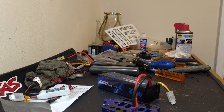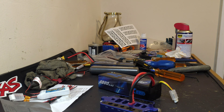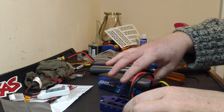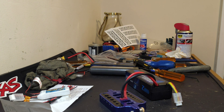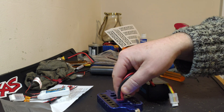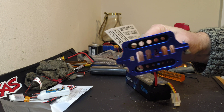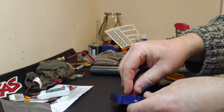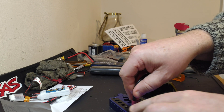Hello YouTube, welcome back to WTFRC Cars. Let's do a bit of a beginner's guide on how to change the plugs on a battery. This one's got a Dean's T connector on it. We've got this nice little clamp that makes it a lot easier — you literally just place it in, tighten it up, and that will hold it in place for you.